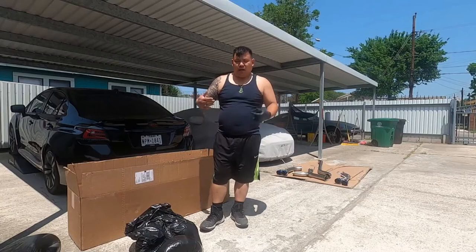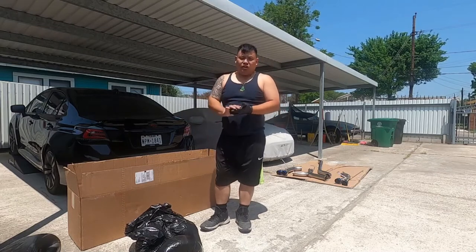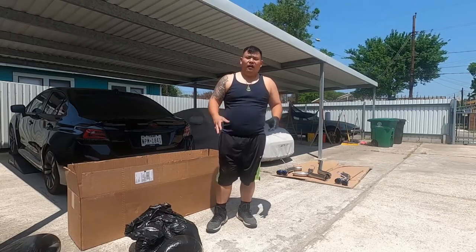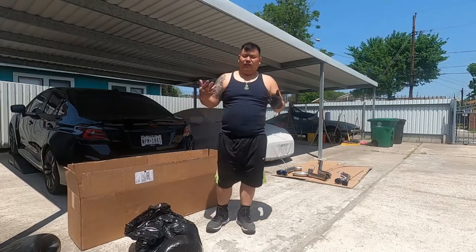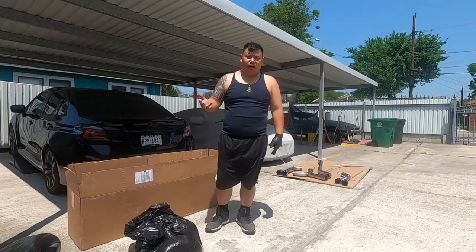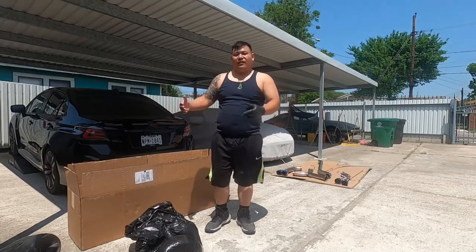We want to run it and let her enjoy it, and I enjoy it as well, for upgrading the exhaust system, okay? I do have plans for this car. I do plan to buy a Cobb J pipe, a cold air intake, and also the Cobb Version 3 diagnostics and tuning for the Subaru. If you install the cat-back, you don't need a tune. But if you install the actual cat converter, changing out the stock one for a J pipe like a Cobb or an ETS or Invidia, you're gonna have to get a tune. So why do the J pipe and go buy the Cobb Version 3 and tune it? I might as well just do all three at one time and tune it one time, and we'll be done. Because if I install a new cat on this car, the Cobb cat, I have to get a tune. And if I install the cold air intake, I have to get tuned again. It's a hassle.